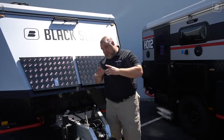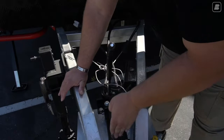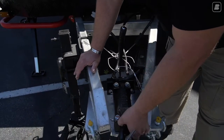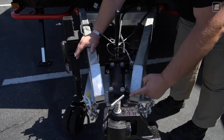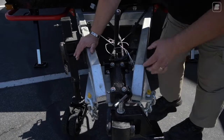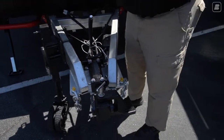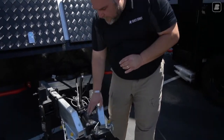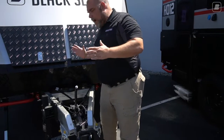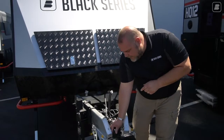Part of this unit that you cannot see is a very large heavy-duty spring inside. If you're off-road, you pull the clip out of the way — now you have about an inch or so of gap. The idea is that when you stop while off-roading, your trailer keeps coming forward, and this very large spring will take the brunt of that hit rather than it slamming into your vehicle. That is the purpose of that heavy-duty spring.